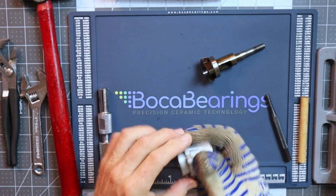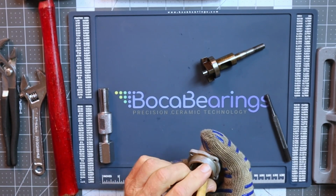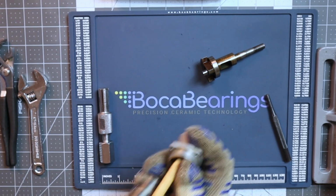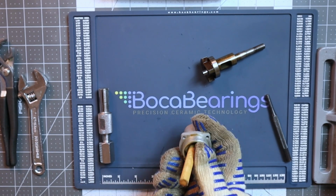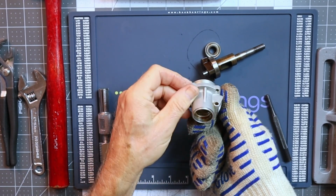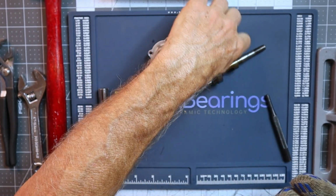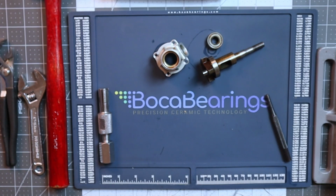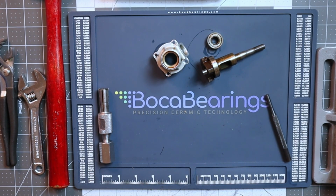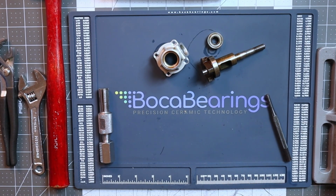We've got that off. Now we can just drive this front bearing out, which should just be a quick few taps here. And our front bearing is out. So there's our front housing. Crankshaft removed, bearings out, and now that just needs to be cleaned in the ultrasonic. Let me see how hot this is, because right now I've got to get that bearing off there, and I don't really want to burn my hand, but I think I should probably leave my glove on.